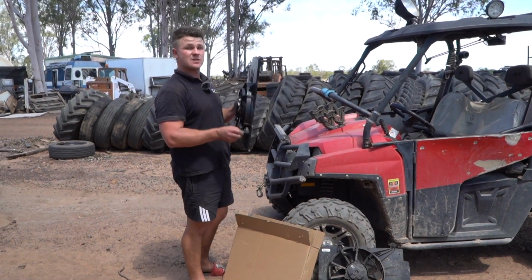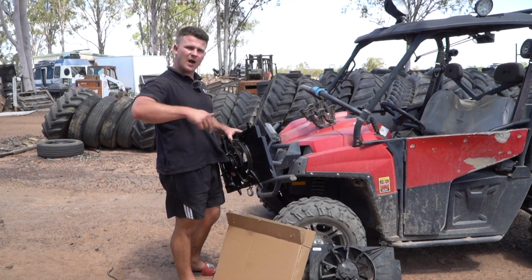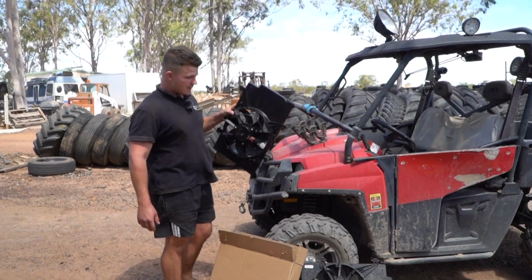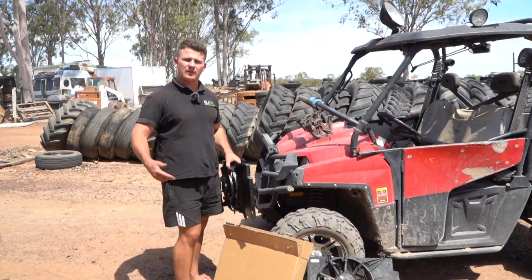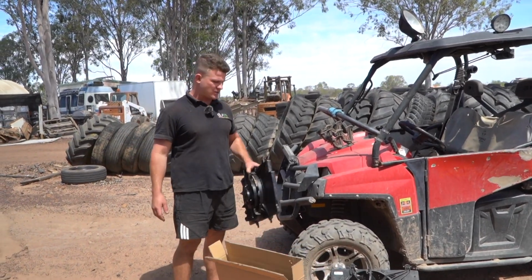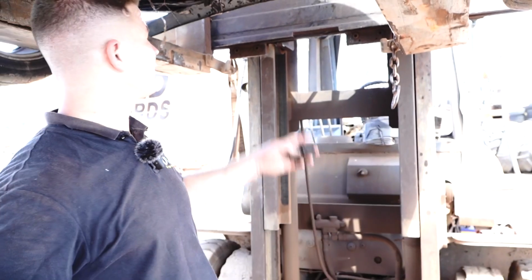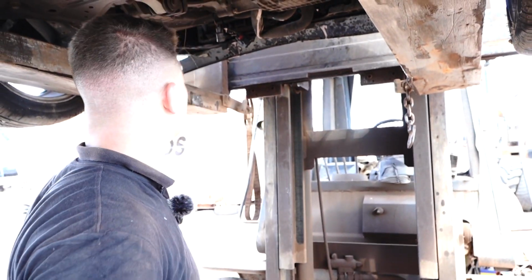And then, guys, at this point I'm explaining you need to take the resistor out of... Oh no, ours actually comes with the original resistor or a replacement resistor. So it's going to be fairly straightforward. We've got to put it up from underneath, smack it straight back in the car, clip it back in, and we're good to go. So it's now time to put the fan back up into the car.